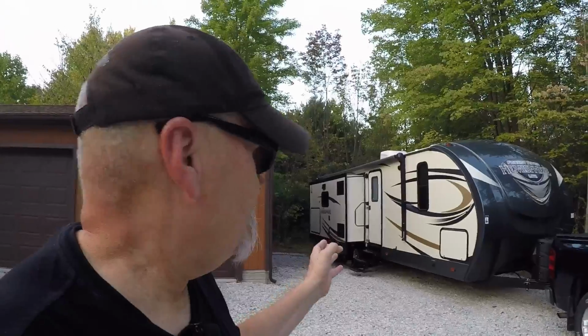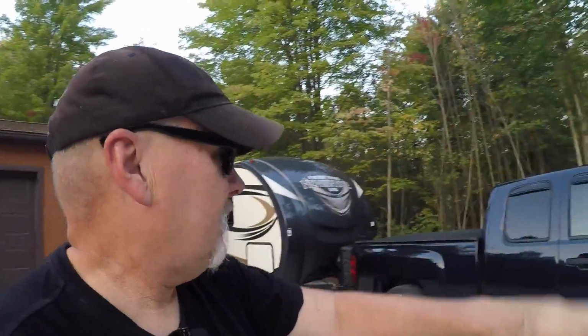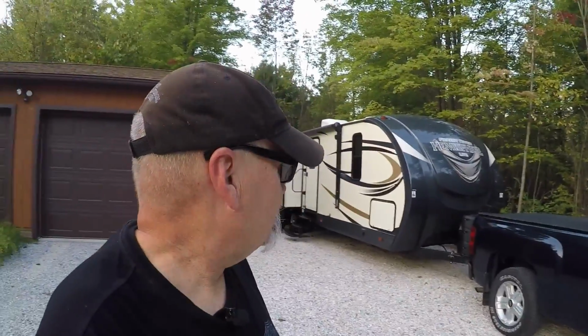And like I said, this is a 34-foot trailer. So the most difficult thing for me as a driver is negotiating it. Now, the weight of the truck to the weight of the trailer is pretty important, and I'll tell you why. The truck may be able to pull it, but you're going to have to stop too. And when I hit the brakes on the truck, if the trailer weighs too much, it's going to push the truck down the road, and that can cause some real serious problems, especially when it's wet or when the road's slippery. So you want to drive very cautiously under those conditions.